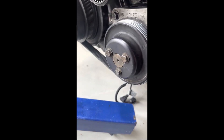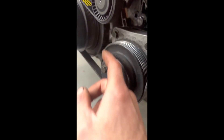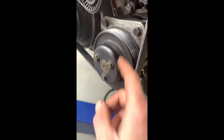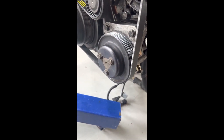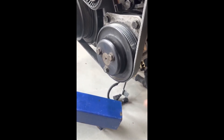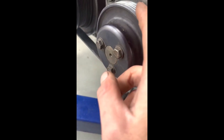Another thing to note is that the power steering pump isn't going to work on the M50 housing. The alternator and tensioners all work, but the power steering pump won't. I did end up buying spacers that were supposed to make the M54 pump work with the M50 housing, but it just made it sit too far forward. So what I did was get an M50 pump and bracket, and obviously that bolts right up and lines up perfectly.